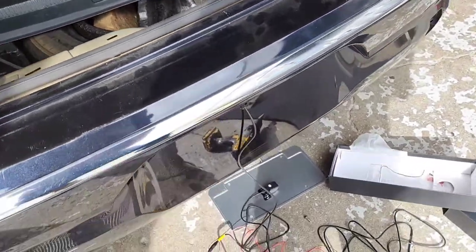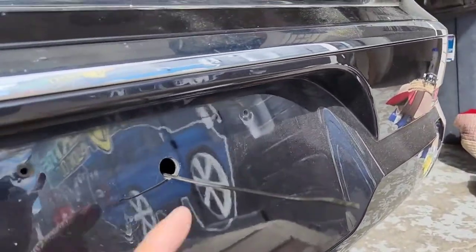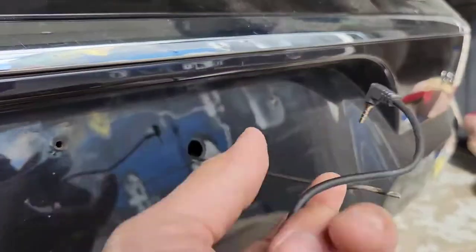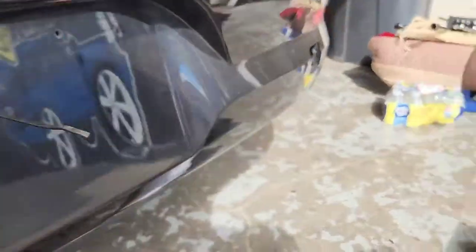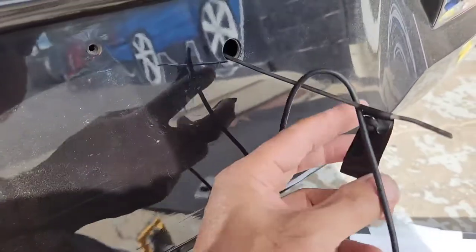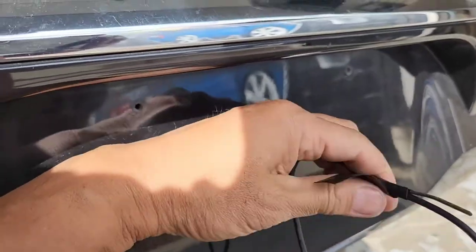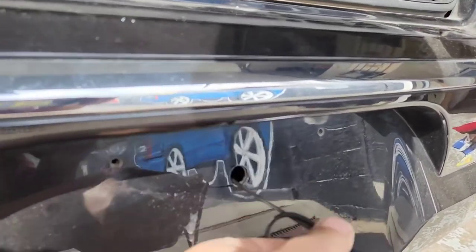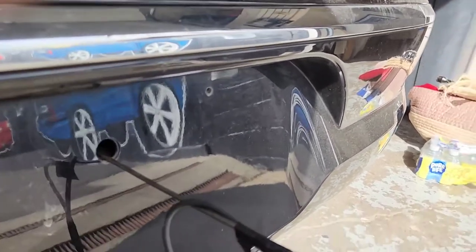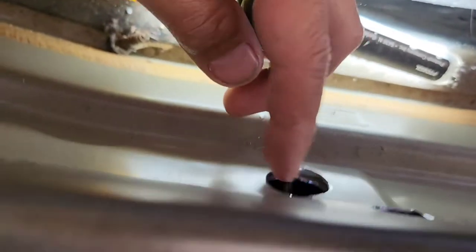In order to grab the wire, you're going to have to use some stick or something and pull it. So I pushed a metal hook, or anything that you have — whatever. A flat hand might work, or you probably need about a 10-inch one. And then you don't want to tie it right here; it's going to get stuck. You want to tie it about a foot or more than a foot. Tie it like this. I'm going to use one hand to demonstrate. So you tie it like that, and then you want to grab this piece — it's going to be a little tight. And you just pull it slowly. You don't want to pull too much either. Then I'll put this thing right there a little bit so I can grab it later. Now as I pull all the wire out here, I got this red wire out here. The holes that I made over here — it's about an inch or three-quarters of an inch — so I can pull the wire easy.